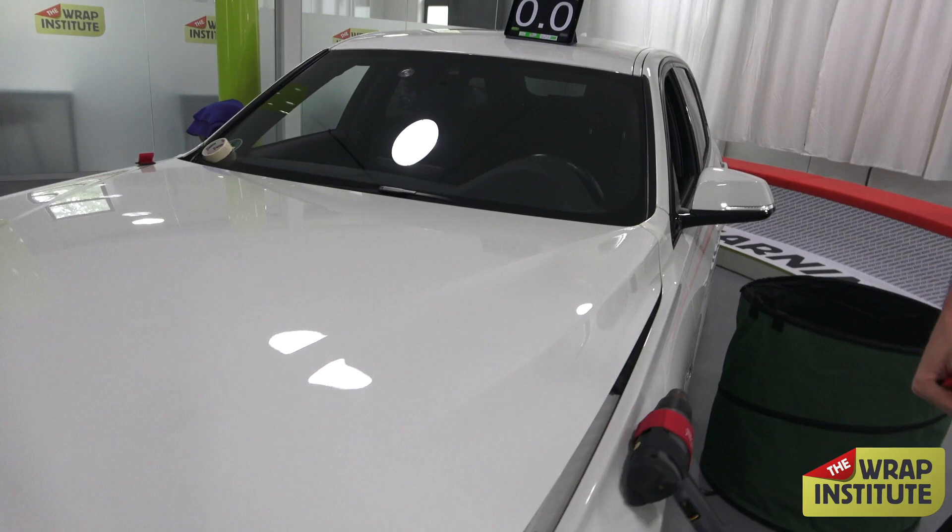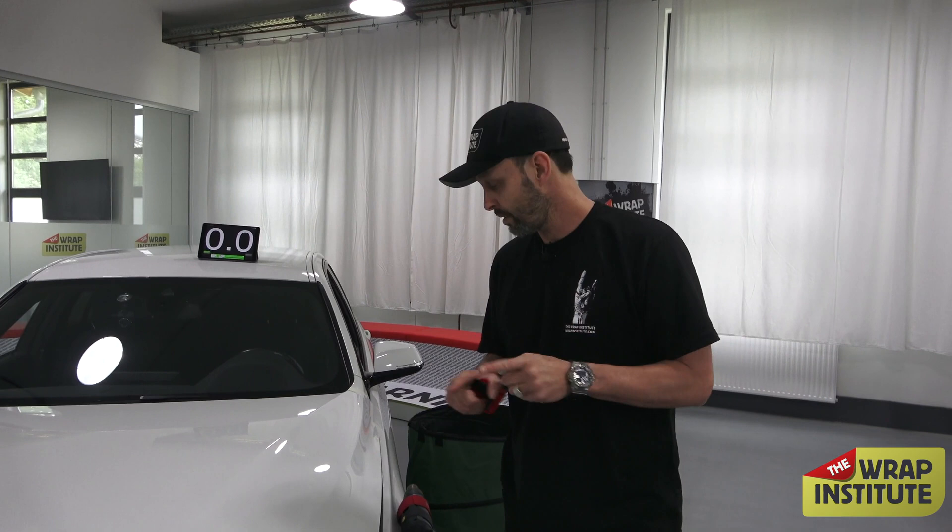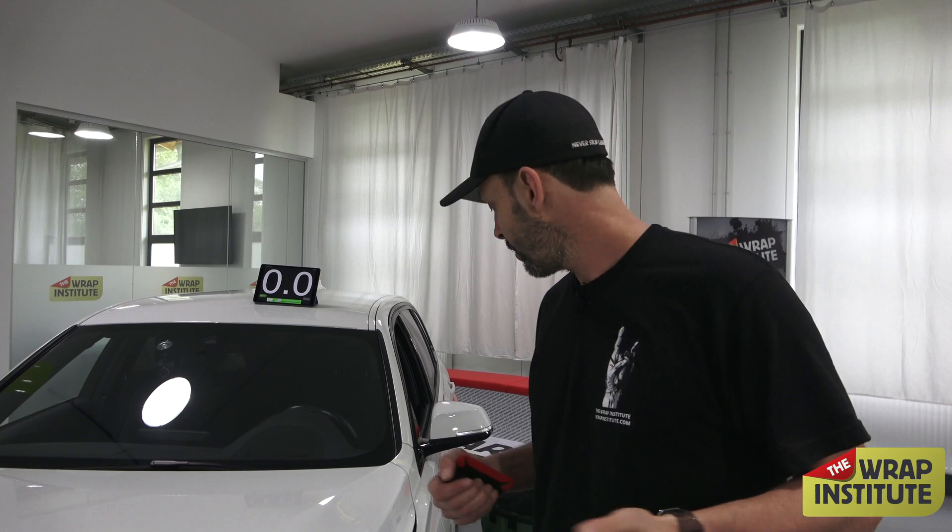At the front of the hood, I put a core tube. The reason I put a core tube here is it's a nice wide gap so I can get the material under here and not have to fight the bumper. Prep is about neutralizing tricky spots, but it's also about cleaning. I cleaned this with a general cleaner, then clay barred it, then degreased it — a three-step process that creates a really good substrate to wrap on, so it holds well for the long term.